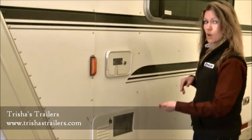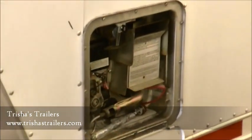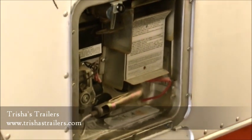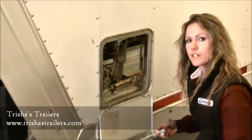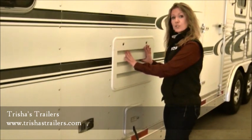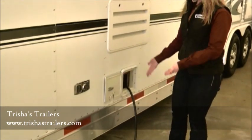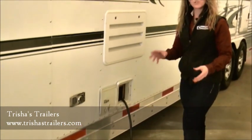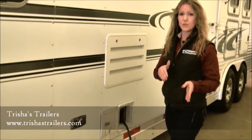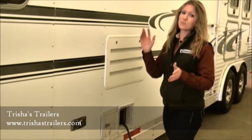Below it, you're going to find your hot water heater. This trailer has been winterized — when we winterize these, we completely clear out all the lines of water, take out the anode rod, and completely empty the hot water heater. Over here is the exhaust for your furnace, and this is going to be the exhaust for your refrigerator. Directly below that is the housing compartment for your shoreline power cord — 110 volt, 30 amp service. Always remember you're plugged into 30 amp service; you don't want to be plugged into 15 amp and try to run all your systems, otherwise you're going to flip some breakers immediately.